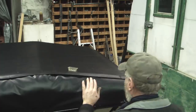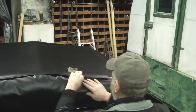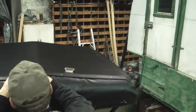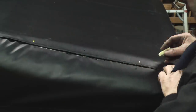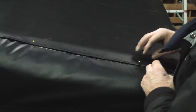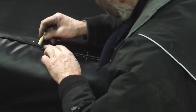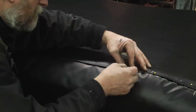I'm going to try to simulate where I would want this to be after it's stitched. I can't really ever get all of the wrinkles out of the side corner at this spot, but the goal at the end is to have a smooth curved seam that fits this top. I'm going to run a chalk line down that will show me where to trim the quarter panel. I'm going to put these little dart marks in so that I can keep it lined back up correctly when I stitch it. There's going to be some stretching and maneuvering, and I have to account for these little wrinkles. Hopefully if we get it right, she'll fit like it should.